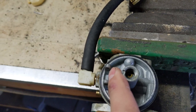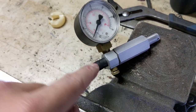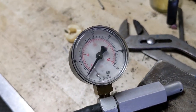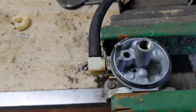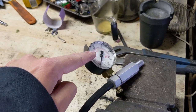We know that there's not going to be any air leaking out of where the seat is. As long as you have a nice seal at your fuel line and your relief valve is closed, this chamber should pressurize and hold approximately 5 to 10 psi if your 90-degree inlet does not leak. If it has a crack in it, then this will not hold pressure.